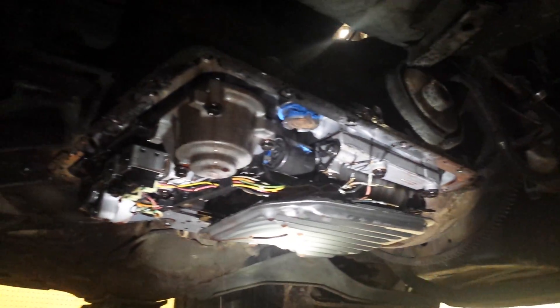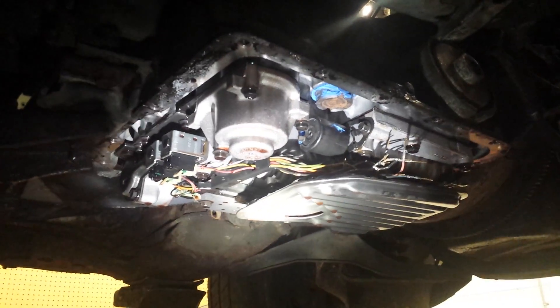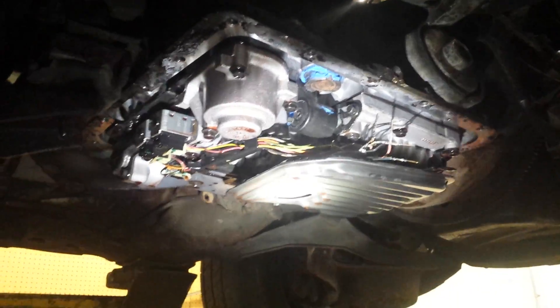I think it's that offset starter and it must not be meshing 100% perfectly because it's making a lot of screeching noise. I pulled those plugs out since I don't need any electrical anyways. I took the solenoid out of the way, moved it, and put it back.